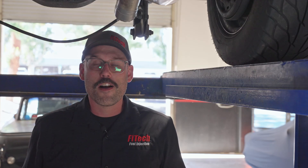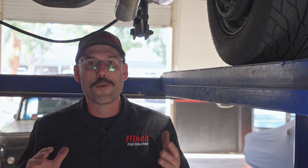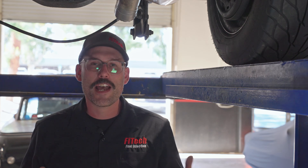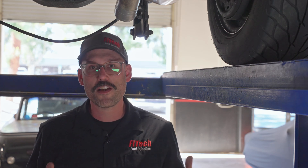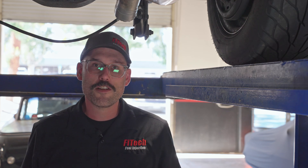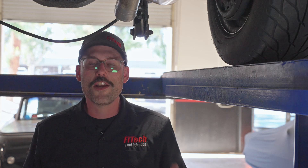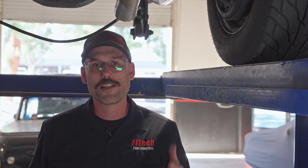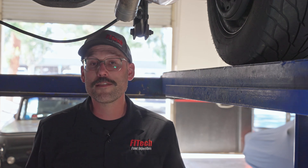So that finishes it for us. We went through the exhaust, found any leaks, and had nothing that would have caused any type of issue for the O2 sensor. I hope this video described how an O2 sensor works and why it's so important to make sure it gets a good reading. Now if you still think you have some sort of reading issue with that O2 sensor, another possibility is a cylinder misfire — whether that's due to a burnt plug wire or some other reason.